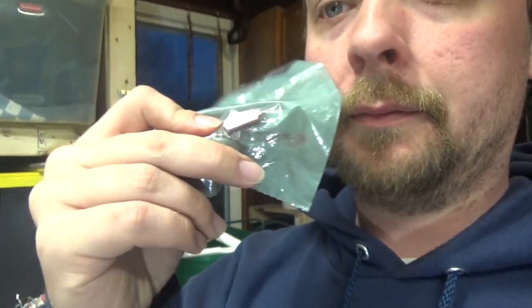There's a known issue with certain ones where the Thermowax gets sticky, I guess, or it just doesn't work. The Thermowax is this little thing that sits next to the engine. When it warms up, the wax loosens up. When it cools down, it hardens up. And so that makes the choke an auto choke. Now the issue is, because it's so cold, it gets hard as a rock in the defective version, and when I go to start it up, it just never warms up and starts working again.